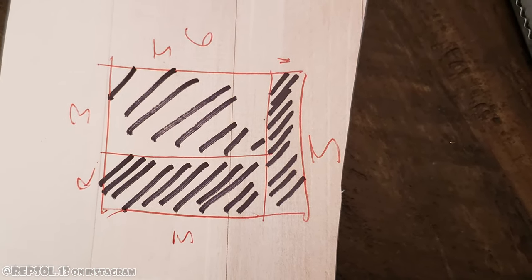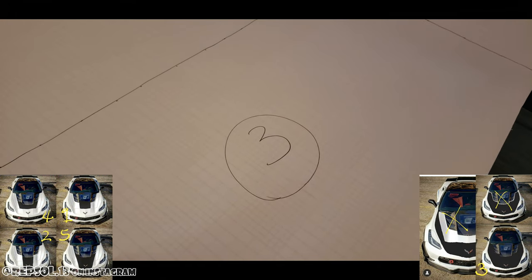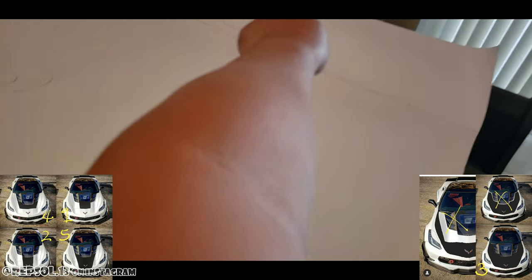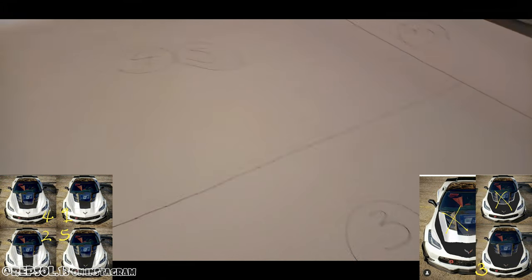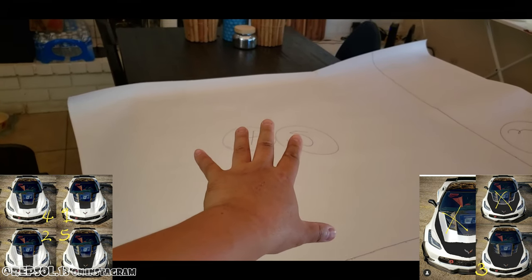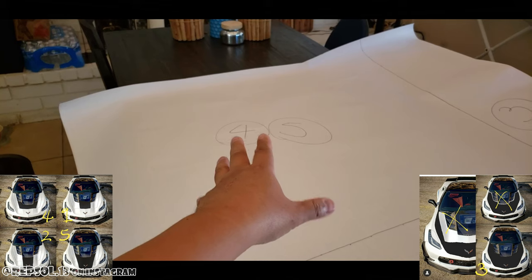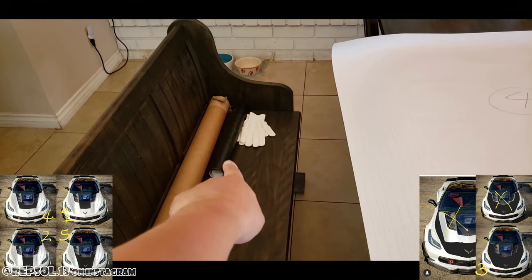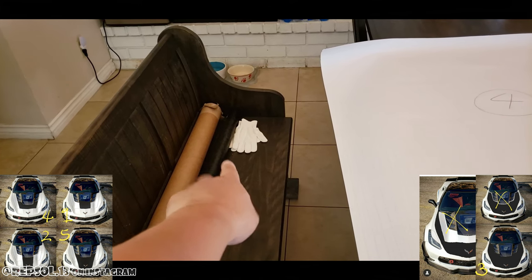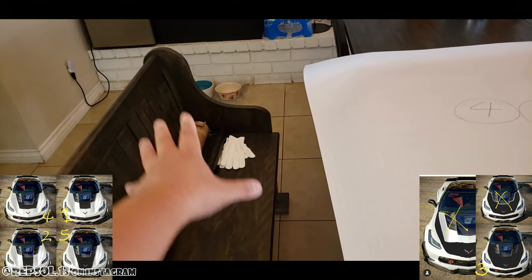This shows the way I'm going to cut out this large sheet of vinyl so that the pattern — the weave — is correctly expressed. I have to cut it this way. This will be for the front for option 3. The front bumper pieces are the two side pieces. For options 4 and 5, also cut correctly for the carbon weave, it will go on the hood and the front bumper as one piece and you can cut it later. Option 1 and 2 would just be that strip of forged carbon — one large strip, about 5 feet — so I can do a pretty good job all the way from the hood down to the front bumper.